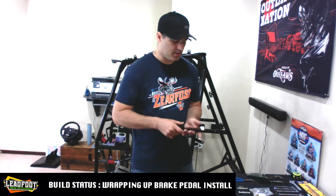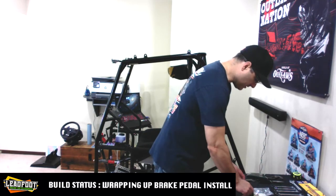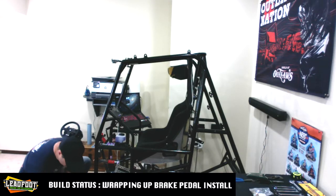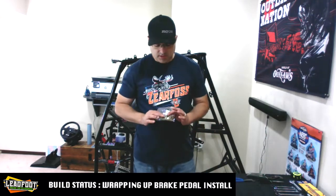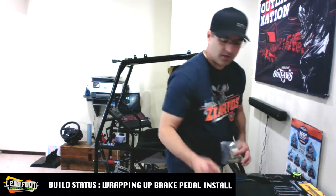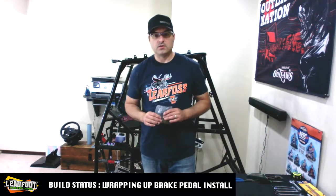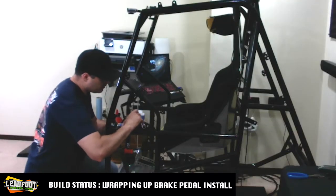So we're going to go ahead and grab our brand new fabricated bracket. We're going to grab some hardware here that we used before. And I am going to need some additional 5/16 flat washers to take the place of the spacer that came with this whole assembly. The spacer ended up being too great of a thickness, so that's why we're going to go with the old down and dirty trick of using flat washers for our spacers. Tighten this down a little bit so it starts grabbing.